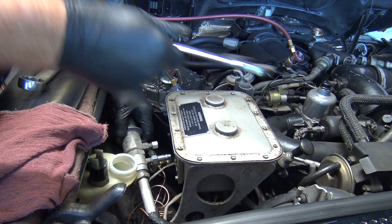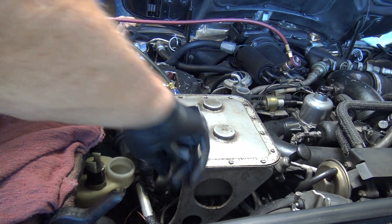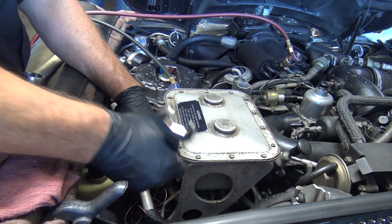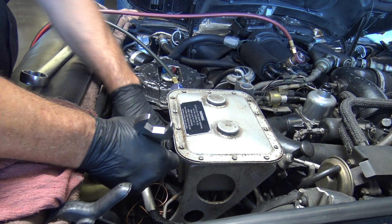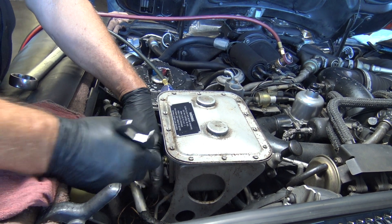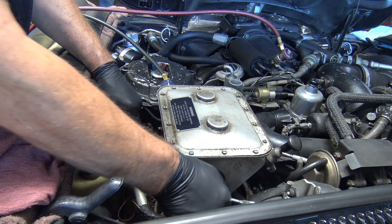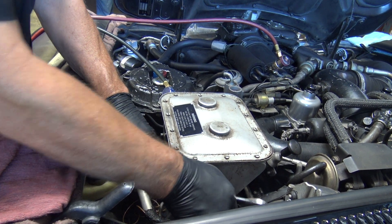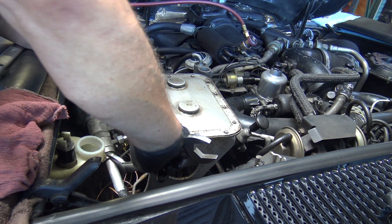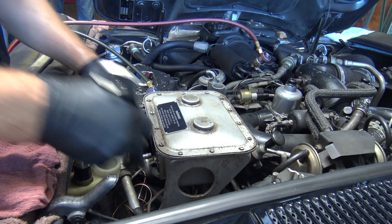Are the expansion valves with R12 compatible with R134a? Yes — most of the components will go either way now. The big difference is oil. When they first came out with the 134 they used a type of oil that was really corrosive, so they had a lot of problems with aluminum components and had to go stainless steel. They used ester oil. Then they went to a different style oil that's kind of compatible with both. If you change out a compressor and flush the system you want to get all the old oil out. This compressor has an actual sump — it holds a lot of oil, about 8 to 12 ounces system charge, and it has a little oil pump that lubricates the bearings.